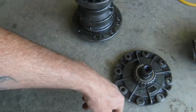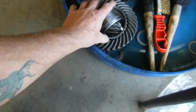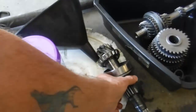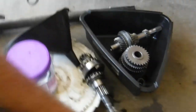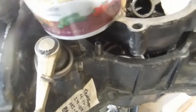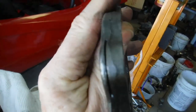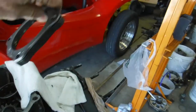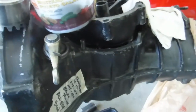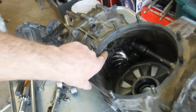Usually you spend more, you get more, right? Here's a quick look at a late style pinion, and here's the pinion nut that holds the pinion bearing in place. It's got threads on it and you have to have a special wrench to tighten that down. This one over here is an earlier one and it takes the four-hole flange. I had one of each of these transmissions, and this one has a forged flange — you can tell it's a racing flange because the racer ones have that slot in there. These are made out of a little different material than the original ones; the originals are a little softer, these are stronger. One was a four-bolt and one was a modern screw type.